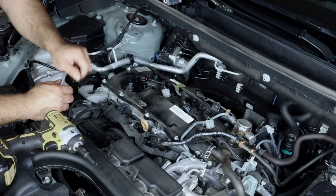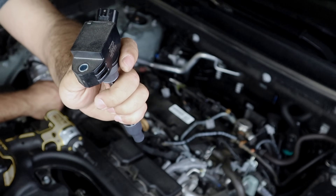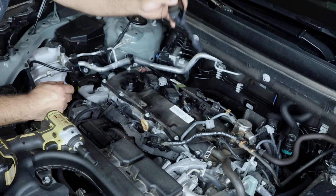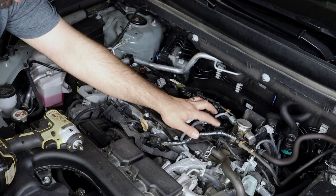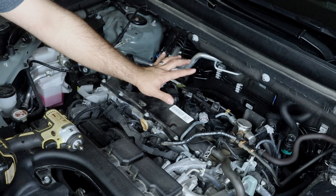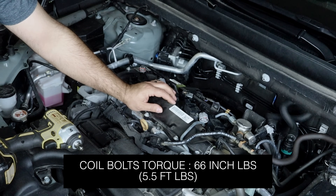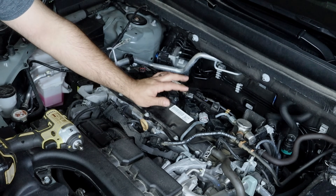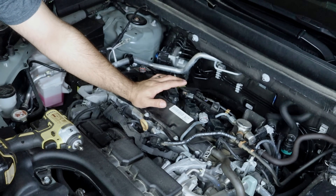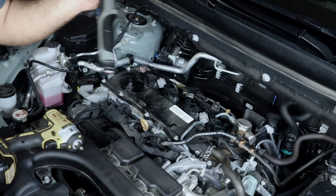Let's go ahead and install the ignition coils — just push them down and make sure that rubber weather seal is there and you didn't lose any. Before tightening, remember this is a plastic valve cover, so you may want to torque the coil bolts to spec so you don't over-tighten them and pull the sleeve out of the valve cover. The torque spec for these is 66 inch-pounds — not foot-pounds. That converts to 5.5 foot-pounds. If your torque wrench doesn't go that low, use the lowest setting, but do not exceed 7 foot-pounds.